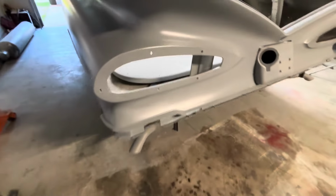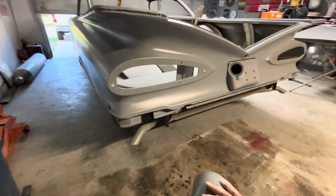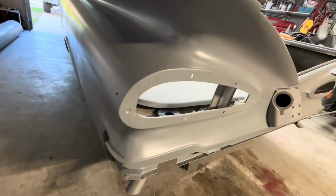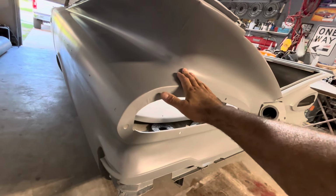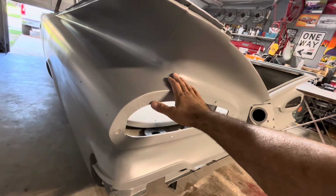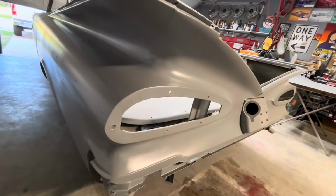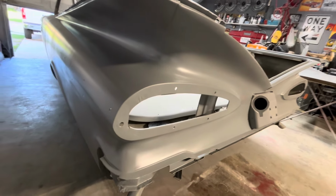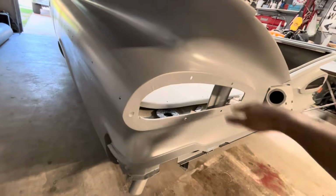when I was going over it with the blue disc, it just put ruts in the lead, and then I had to go back and fix that. Lead is really soft, so when you're going over it with something abrasive, it just gives in real easy, especially with the heat that the blue disc put out. I made a mess right here. I'm not afraid to admit that. I fixed it, obviously. Everything is just perfect, just the way it was.